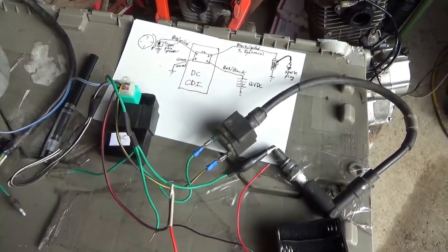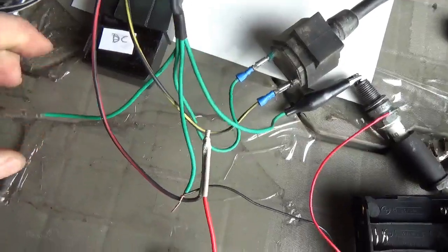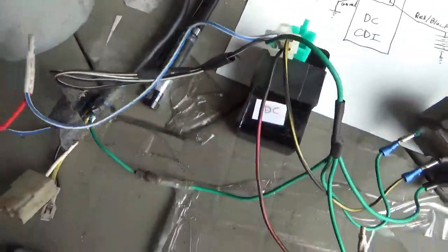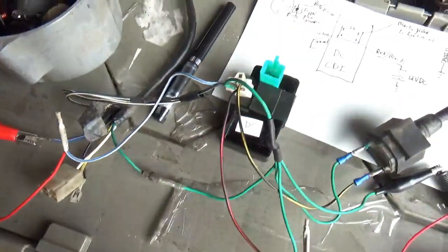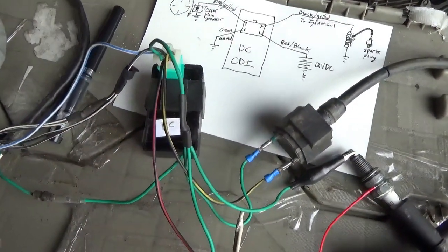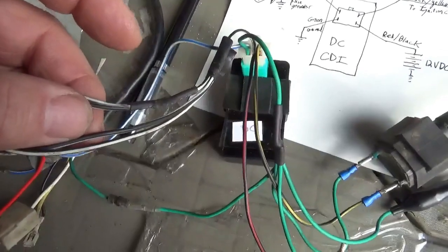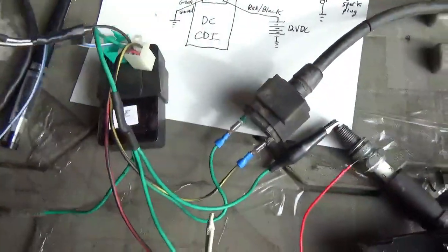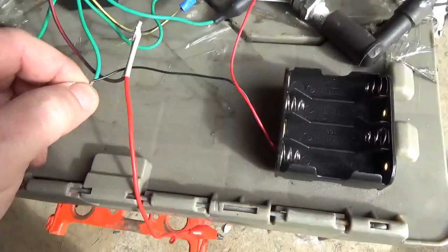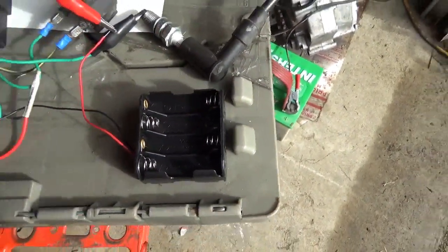With a couple of substitutions — first I plugged in the DC CDI, basically the same wiring diagram. To hook it up correctly, I plug in the ground here, and that takes care of hooking up ground to my pulse generator. The blue and white wire hooks right to the blue and white, so now I have a pulse signal coming in to my CDI unit. This connector, which is normally your on/off switch — black and white — notice it goes to nothing, so you can just let it swing in the breeze; it's not important. The other connection is 12 volts worth of batteries, with the negative going into ground.